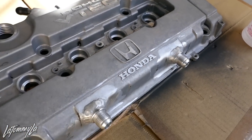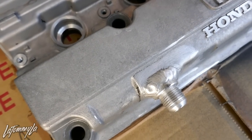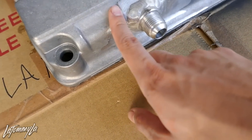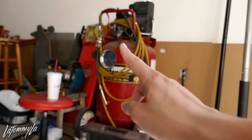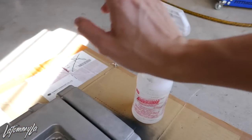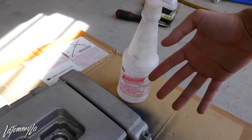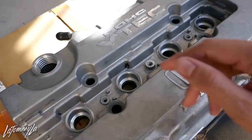Here's the final product after stripping it three times. There are still little black spots here and there, but I'll take those off or maybe just leave it since it's not that bad. I already sprayed it down with an air compressor, got all the water off, and cleaned it with alcohol. The reason I used alcohol is it's a good cleaner and it evaporates. Now it's all ready for paint.